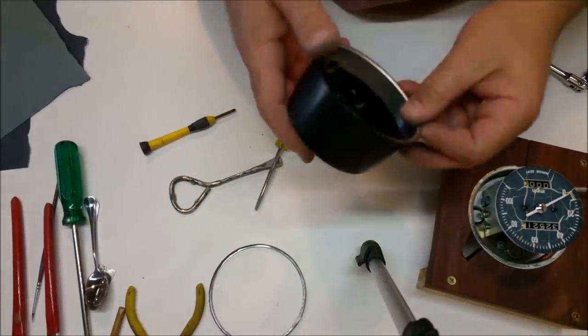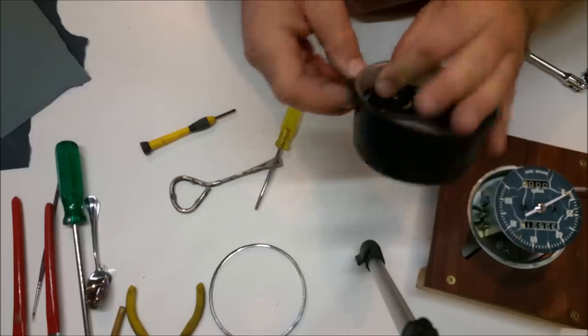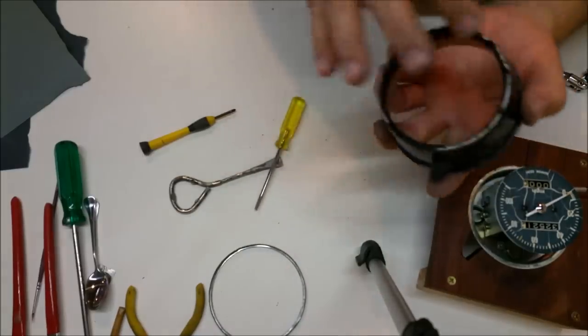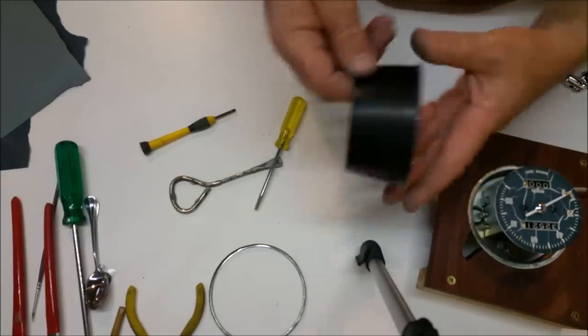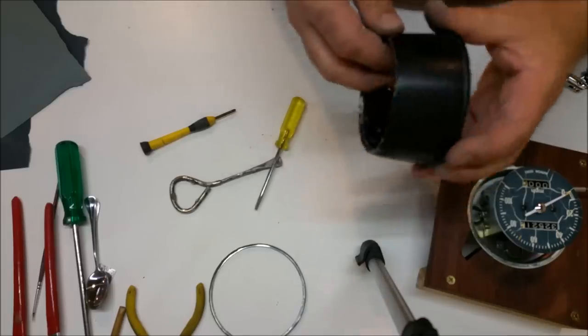The ring - there's a gasket here and the gasket goes around the inner housing. If we pull that off, there's the inner housing that blends into the inner. Now that gasket has a key on it - there is a cutout somewhere on the lower edge. We can keep that together with the gasket in tow. There's the housing. The grommet there is glued in and that's the reason that it's split there. We're going to rub it back. The paint is stable so we can paint over it. The other one I threw in a bucket of thinners and this didn't move it - so I don't know what sort of paint that is, but it's very good.